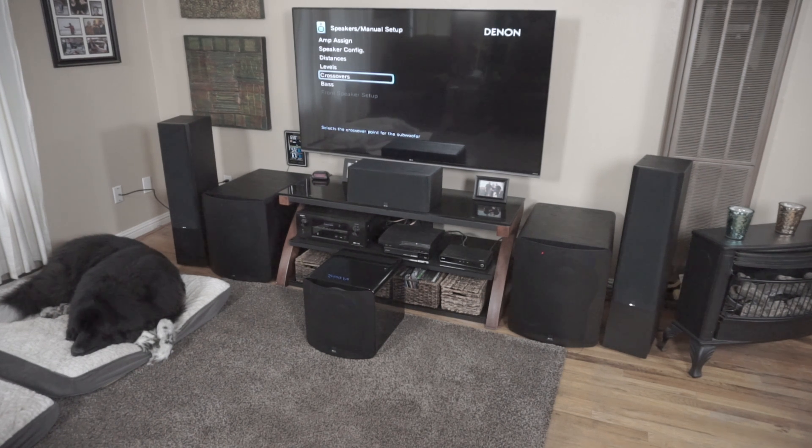I've gone over how to set up your subwoofers and your system, and the fact that you should set your crossover to about 80 most of the time — like 90% of the time. And of course if you want to set it a little higher, that's fine. But if you set it lower, you're kind of taking away some of that low-frequency signal that your subwoofer is good at. The subwoofer operates in such a narrow range that you don't want to take away too much from it.